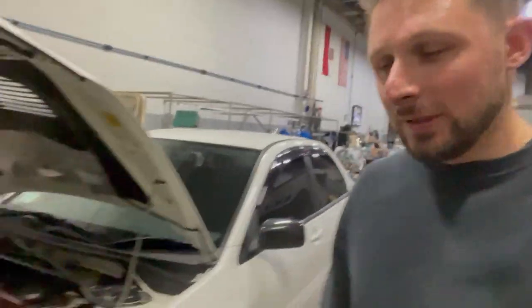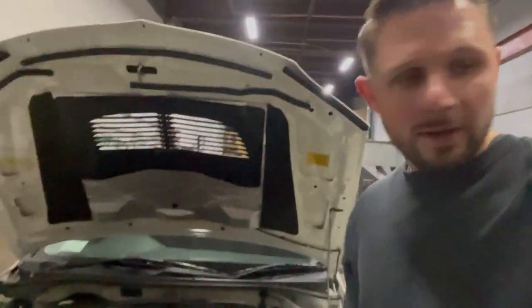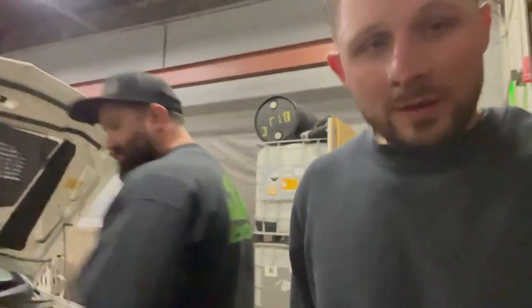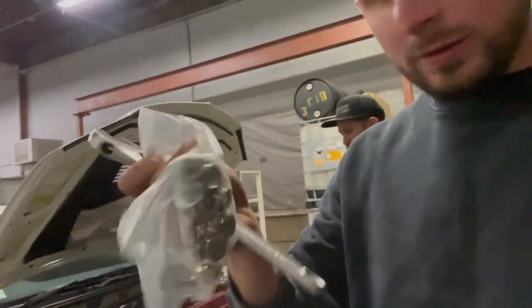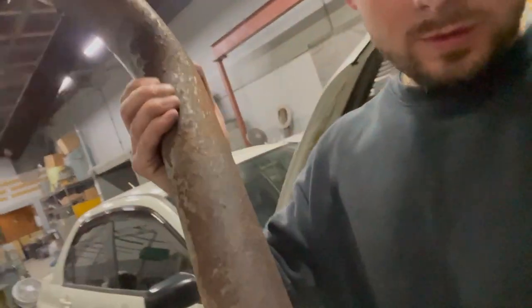All right, it's day two. We're pulling the studs out of the head. They weren't siliconed on the bottom there. Apparently they go into the oil galleys, so we're gonna fix that. And my buddy Kyle sold me on some nice ARP hardware to go in there with my manifold, but eventually we'll change that too. All right, so now that the studs are out and I got those ARPs, I think we'll move on to fixing this.